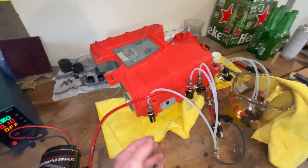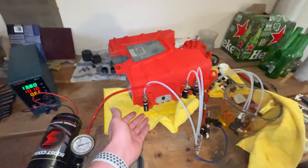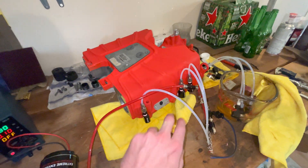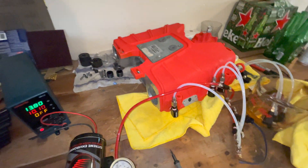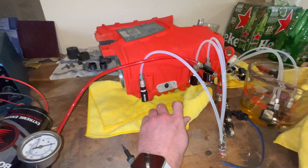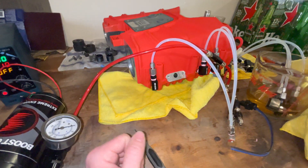I could have put the SRM spacers underneath and raised the blower up, but I didn't want to do it. I thought this was a really cool idea, and the fact that I wanted to cool down the sensor so the sensor actually sees what I'm injecting versus if I went with the SRMs - yeah it would increase the octane count and cool the air, but that sensor ain't going to see it. So by doing this whole setup you can actually cool it down and not cause the timing to pull. I could go and make my own custom tune - I do my own tuning myself, I work for Velocity P doing all the calibration engineering. I could delete the correction map or zero it out so it doesn't pull any timing when this thing gets over 80, but why? At least with this kind of setup, people running tunes like O34 that don't have it zeroed out could run this versus just putting spacers underneath.